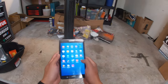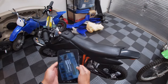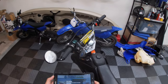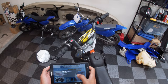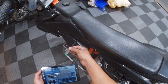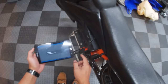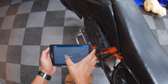I already downloaded it ahead of time - it's called DC Adjuster. We're just going to open that up. Do not twist the throttle or try to run your bike whenever you have this app open and connected to the Kelly controller. Let's key on. Click yes, continue, then Bluetooth - you'll see that the Bluetooth dongle is flashing when it's keyed on, but that does not mean it's connected. Then we're going to click Connect. I already paired it with Bluetooth on this tablet so it comes up as HC06.